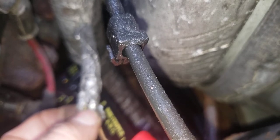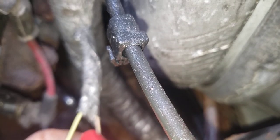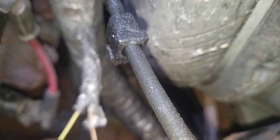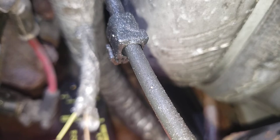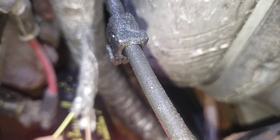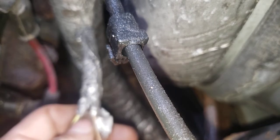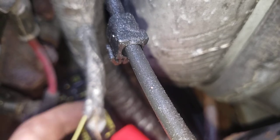This is a General Motors Express 3500, 6 liter engine coolant temp sensor. Call it a pigtail replacement. I need a little more off than that. This is hard to get my hands in here. Now, this would be really hard if I didn't already have the fan shroud off and all the other stuff. So you gotta take everything off to get to this. It is a little more difficult to get to the doghouse if you take that off from inside. I've never done them that way. I've always done them this way. I did this on my Suburban. Same motor.